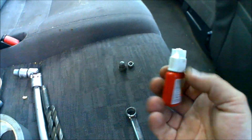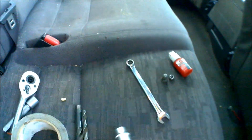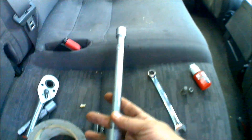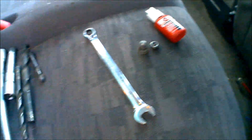What I'm using tool-wise: we need a couple of 10mm bolts here that I'm going to lock tight together, which I need the 10mm for. And this massive 10mm here — that's going to be part of it. What I'm going to do is put that on the nub that sticks out of the transfer case, attach this to it, and then we're going to make a hole somewhere in the truck so I can manually activate it myself. To do this you're going to need some extension bars you don't want, a 10mm you don't want, at least a knuckle you don't want, a couple of 10mm nuts, some lock tight, some tape — this happens to be duct tape — and whatever you're going to activate it with.